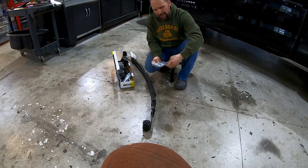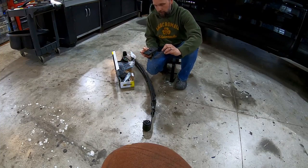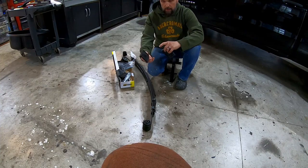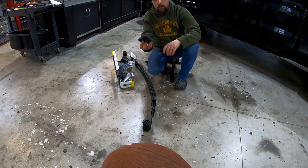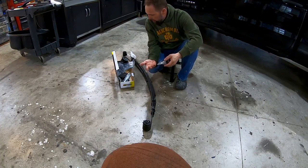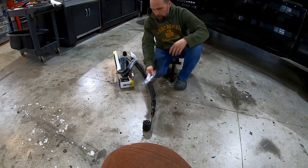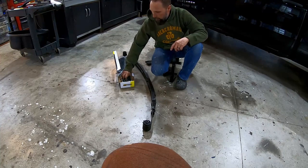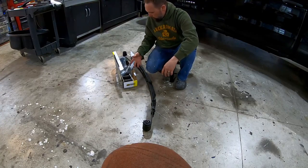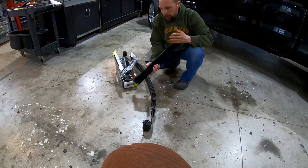I have a Ford 9-inch in that car and I think the U-bolts will go around — we'll find out. The kit also comes with a new bushing pad. Just as a comparison, the old ones have just mushroomed and come completely apart — everything on them is rotten and hard. It also comes with the little clips that go up under the belly of the vehicle for the front mount, new bolts for the front bushing, and new bolts for the front mount plate. This is pretty handy to have everything in one spot — it's about a hundred bucks, a pretty good deal.